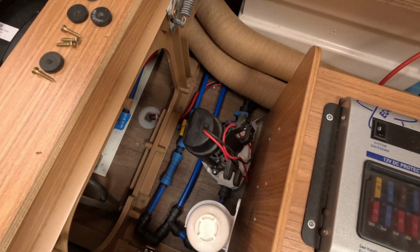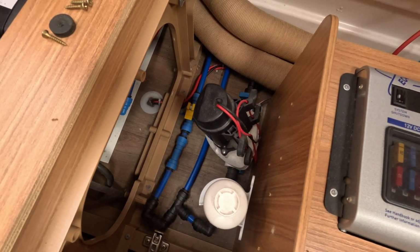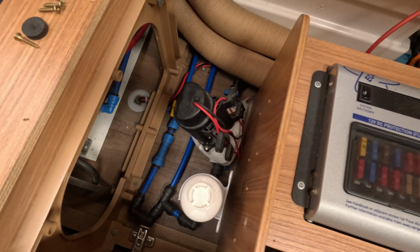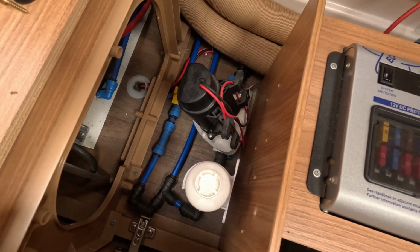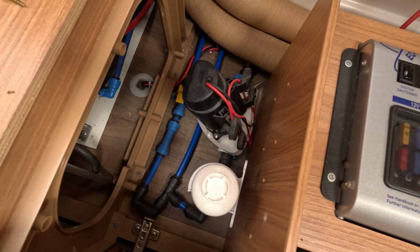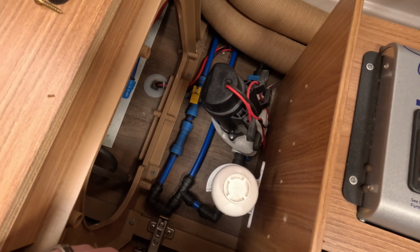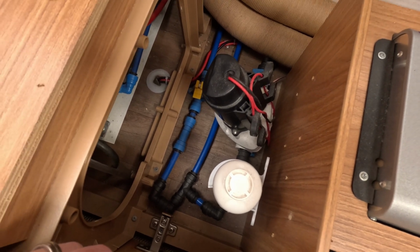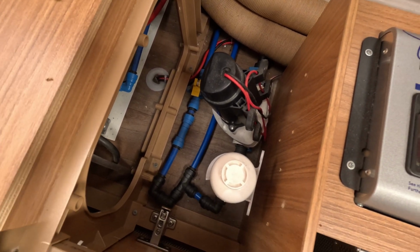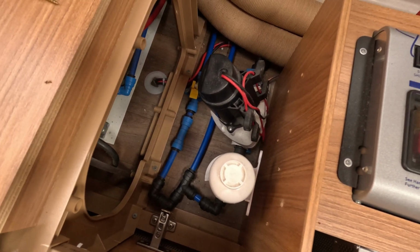Now, just to let you know, this is still pressurized, in terms of the water's actually in the system. I haven't bled it down because all I'm doing is putting these spacers in. If you are going to start playing with the connections and trying to get the right distance, you're going to need to drain it down, because you don't want to suddenly have a water leak or a pond happening within this space. So depending on what you're doing, take the right action.